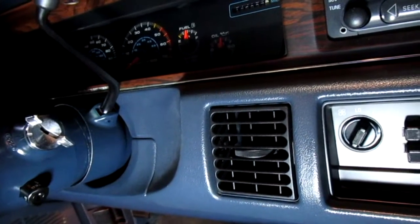You have a bunch of screws underneath here — I think there's like six of them: one, two, three, four, five, six. There's six of those that got to go. Then you open up your glove box — 92 Olds — there's one over there that's hidden. There's another one underneath there by the parking brake. This has to come off — it's just little screws underneath there. If you get that off, this goes off first and goes on last. That little thing is just a little clip over here and a clip on the other side.